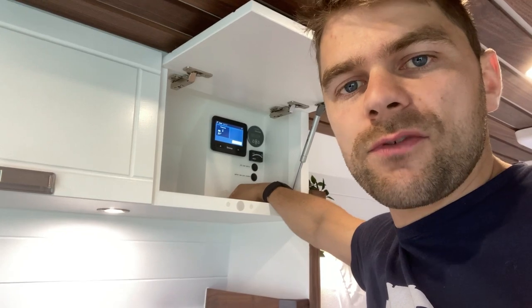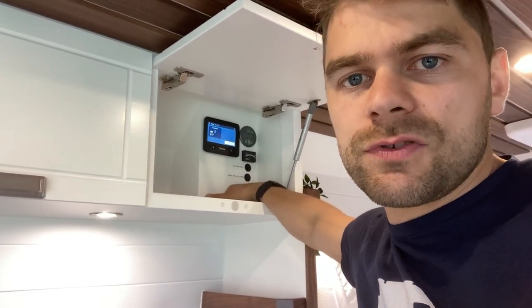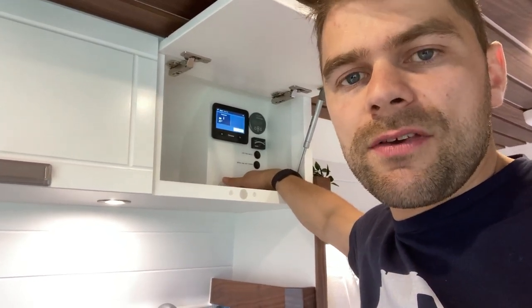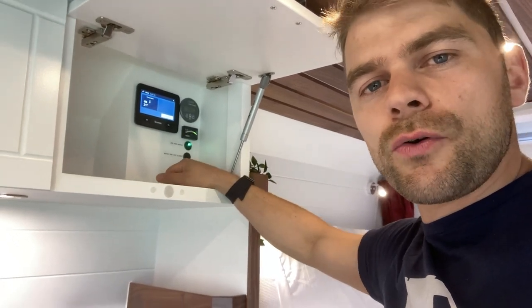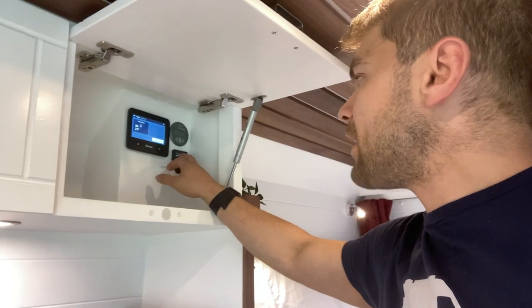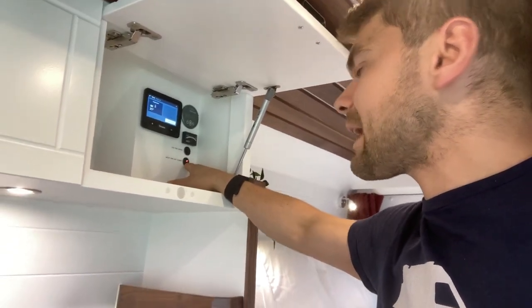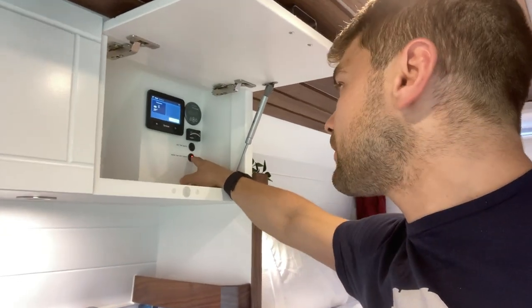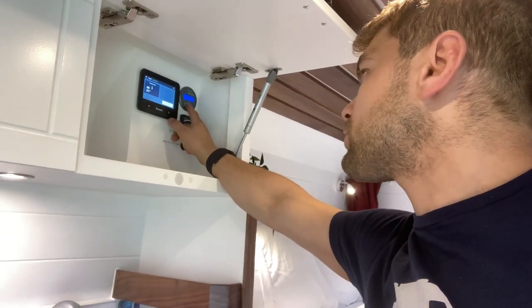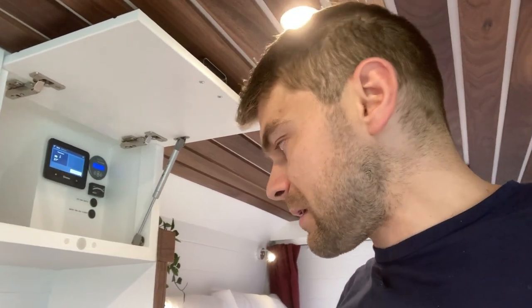As you're trying to remain off-grid you want your power in to be greater than your power out — hence why we've increased the solar panel on the roof to 540 watts. We have also added a second Orion DC-to-DC charger, so when this van is driving it will be generating 60 amps of charge into a 320 amp hour lithium battery from Romer, so quite a lot of capacity to go off-grid. We've also got the LPG tank switch — an electric solenoid on the tank itself — so you don't have to crawl under the van to shut off the bottle, just a rocker switch, with a level gauge above to let you know when the LPG tank is running low. Below the tank switch there's a water tank heating element switch, so in cold weather you switch this on and the fresh water tank's heat element prevents it from freezing. You can toggle through the battery monitor to work out if your power out is more than your power in and start turning items off to remain off-grid.